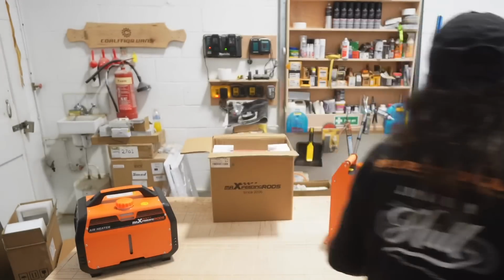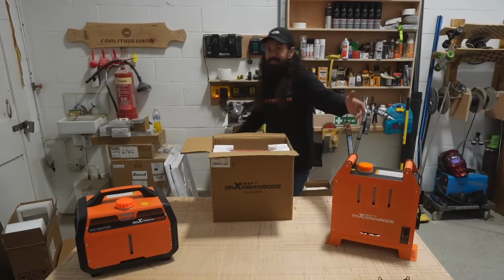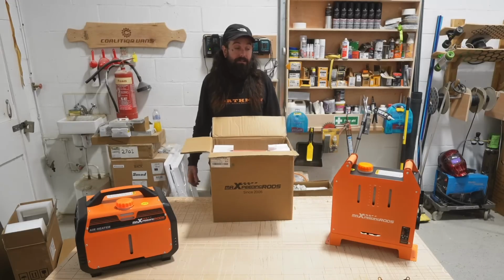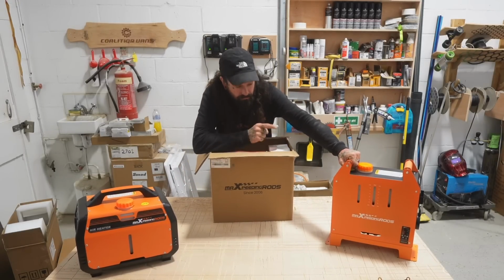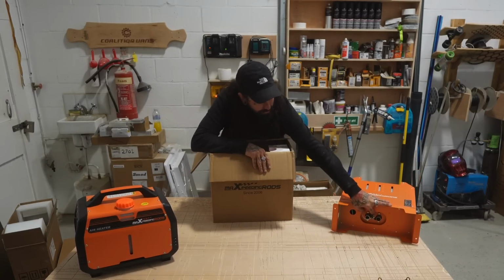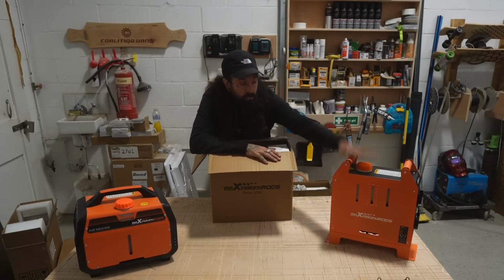This one here, I'll show you, it exhausts out the bottom here. So some people do install these into vans and then they leak fumes into a van and then they get upset about it and then they slag off diesel heaters saying that they're not safe, and normally it's an install error. If you ever see a van builder install one of them in a van, just shoot him straight away, because that's not safe. You'll never really get a permanent safe seal on that exhaust, especially in a moving vehicle that's vibrating and all that kind of thing. So don't install them in a van.